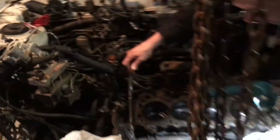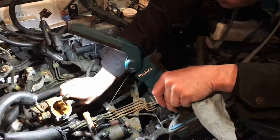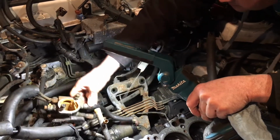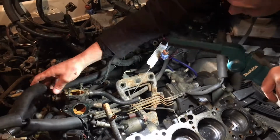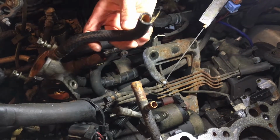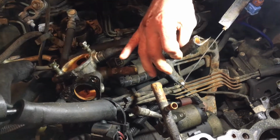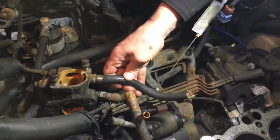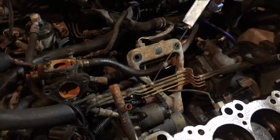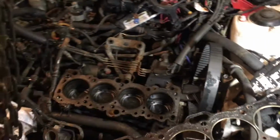That tube, because that's your return line going back to the pump. The housing, that's okay. That's just normal rust. All that is for emission control stuff, those two little vacuum lines. I've got some 3/8 heater hose. Okay, this is the wrong hose I got. You've got the wrong hose on. That's the wrong type of hose. So that's why it wouldn't come off. That's why that thing is hard as a brick. It's a special type of heater hose that you have to use. Yeah, that looks like fuel line. It looks like 3/8 fuel line somebody put on there.